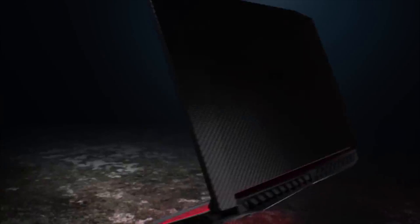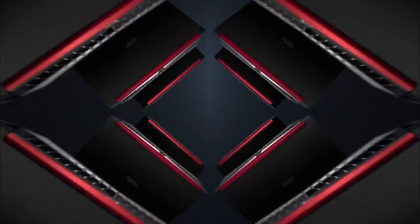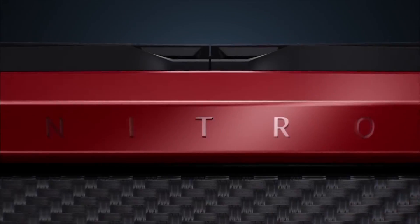The first thing is make sure you have the correct memory type for your machine. Since this is a laptop, the SO-DIMM module is what is needed. Also, the memory needs to be DDR4. The brand that I have is by Patriot and it's the Viper series. So now that you have your desired brand of memory...